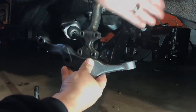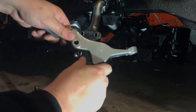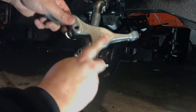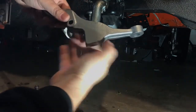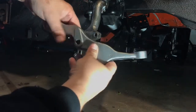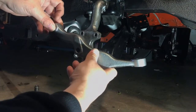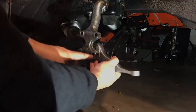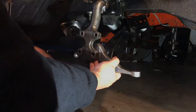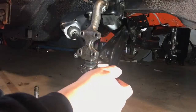The way you can really tell: it curves slightly to the side that's going to be towards the inside of the car, with the steering linkage to the front. There's also a steering stop at the bottom — it's smooth on the outside and stepped on the inside. Make sure you've got the right piece. This goes behind the steering knuckle in staggered bolt holes using longer bolts.